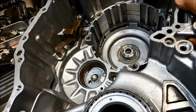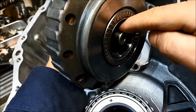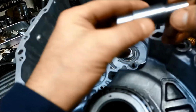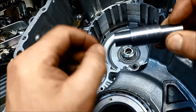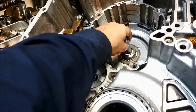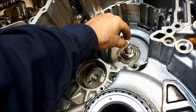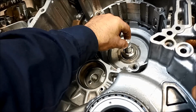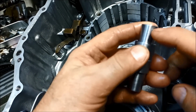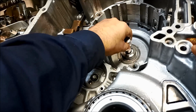What you basically need to do is make a little dolly that's actually that exact same measurement, and I've got one here. One side will be the exact size of that little shaft, and you'll notice, it just goes straight in like that, and you can see there's a little bit of movement there. It's a bit hard to see, but I've got this other side which is 3/1000ths of an inch wider. If I try that, I can't get that in there.